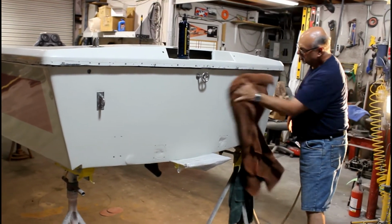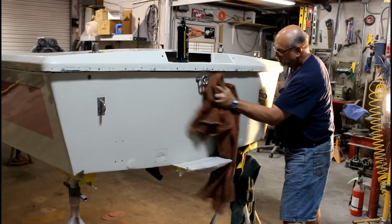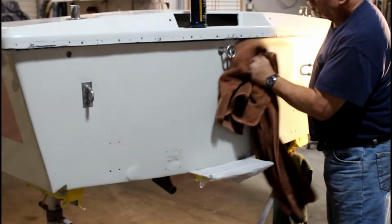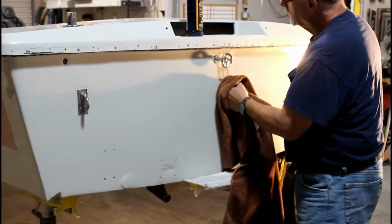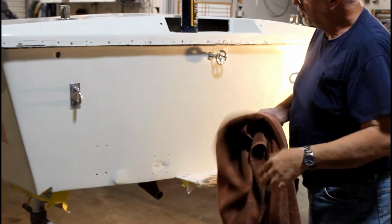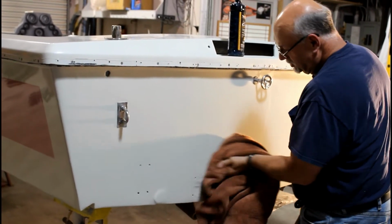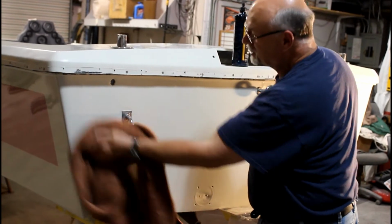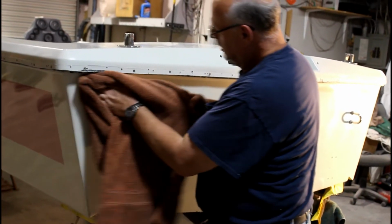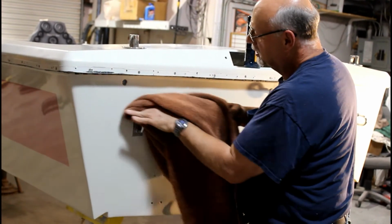Okay, we're just about done here. The block sanding with 1000 grit wet has been done. Block sanding with 1500 grit wet has been done. Machine compounding with the coarse compound and a wool pad is done. Machine compounding with a medium compound on the white pad is finished, and now we've got the final compound, using a black fine pad and a fine compound, done.